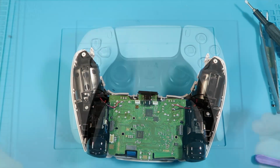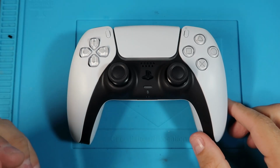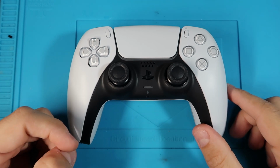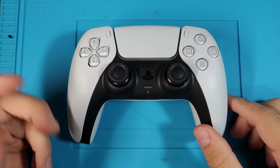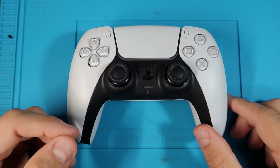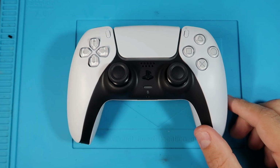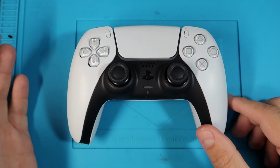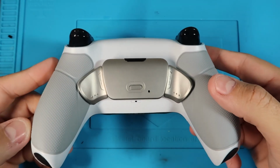Alright, so I've finished the install. Took about 30 minutes. And if you've done the 1.0 RISE kit, it's essentially exactly the same. Just those ribbon cables, you have to take note of what circuit board you're using, and then you just need to fold them the way they tell you or cut them the way they tell you. Besides that, the soldering is exactly the same, and the disassembly and assembly are the same. So yeah, this is what it's going to look like when it's fully installed.